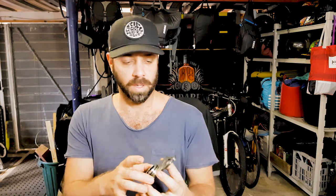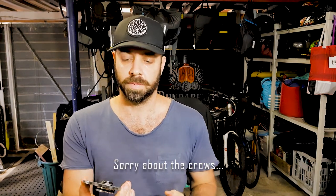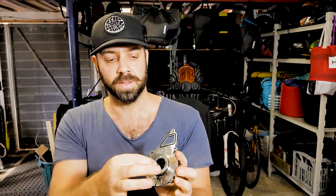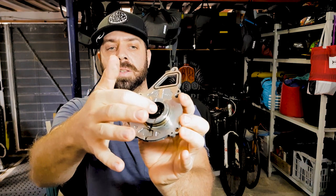Something to talk about before we proceed, and I realized that I hadn't included this in the footage that I previously shot. This mechanical part is actually referred to as a mechanical water seal, and I keep calling it a mechanical oil seal. It does seal the oil from the coolant. So this is the coolant side, this is the side where the impeller is, and you'll see that in a minute, and this is the side where the oil is. This is what actually tends to wear out.